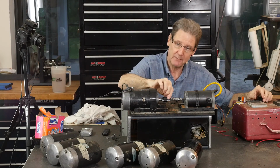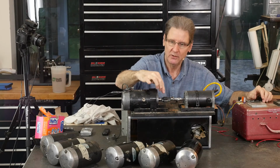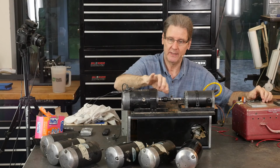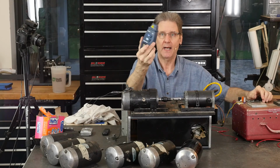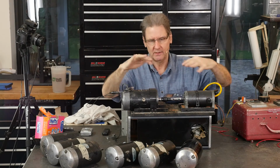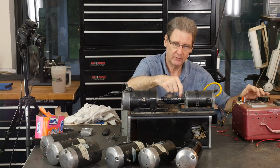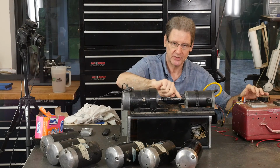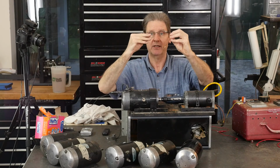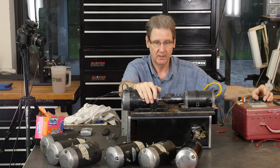But what I did do is I brazed a 1/4 inch drive, I think a 7/16 socket, to an old junk gear, put black tape around it and then a white stripe here so that this tachometer, which isn't working very well, I got another one on order. And it was hopping because nothing was perfect and centered. I took a file and ground flats into the shaft of this. So now two universals are constant velocity for offset. So that solved any hopping problems I had.